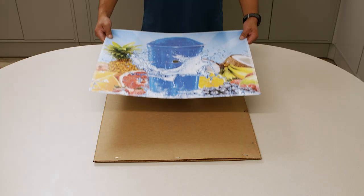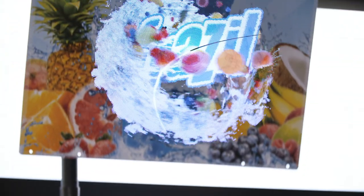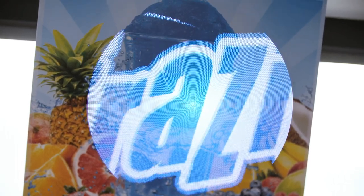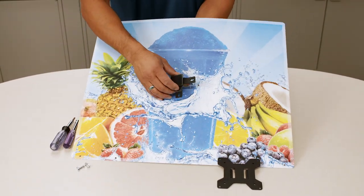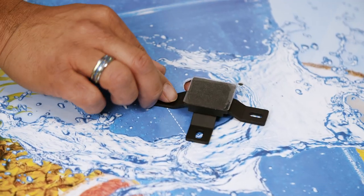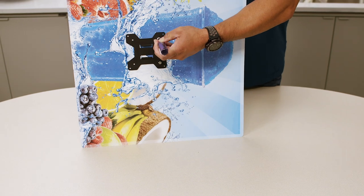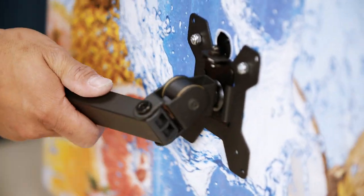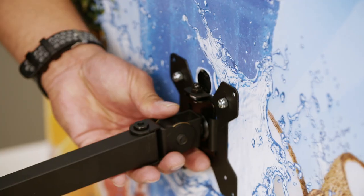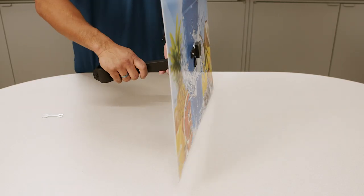Step four: make the swivel arm assembly. For visual optimization of the display, consider placing the hanging sign behind the fan. Discuss first with the store owner or manager on duty. If there is natural light behind the machine, as in the case when the machine is in front of a window with direct sunlight, the hologram image may not display properly. In this situation, the hanging sign must be used or the display moved elsewhere. Place the hanging sign between the VESA plate and mounting bracket aligned with the holes. Securely attach the mounting bracket to the VESA plate using the wrench and lock nuts provided. The mounting bracket should be affixed to the top two holes of the VESA plate to install the fan as high as possible. Slide the VESA plate onto the head of the swivel arm. Slightly angle the VESA bracket downward, about 5 degrees, for visual optimization of the hologram image when the hologram display is hung. Loosen and tighten the security nut with an Allen wrench until the desired tilt is achieved. Using a wrench, tighten the security nut to secure the VESA bracket to the head of the swivel arm.